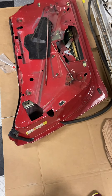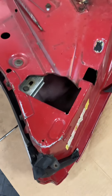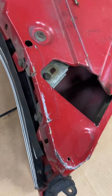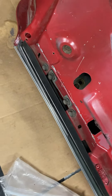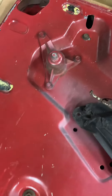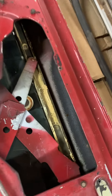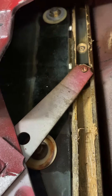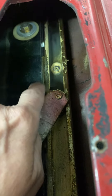I'm going to post a video that may or may not be helpful for others. On these '68 doors, this one is for manual windows — it did not have automatic. Everything was pretty self-explanatory on the locks, the push button, and all of that. However, the one variance we are noticing is that on the bottom of the rail assembly for the window, there appears to be an extra part that is not on the other models. It's hard to see in this video, but back behind this rail here there's another metal piece that I don't see on the other later model C3.